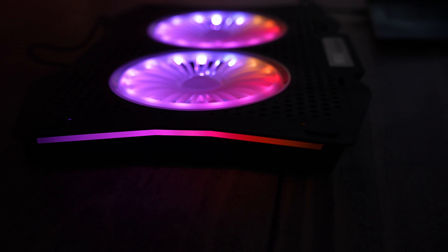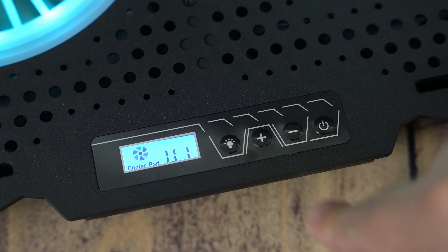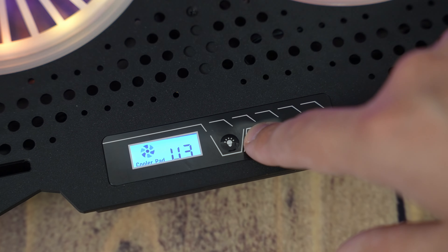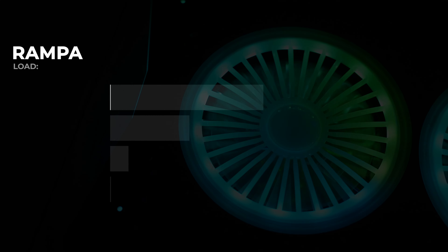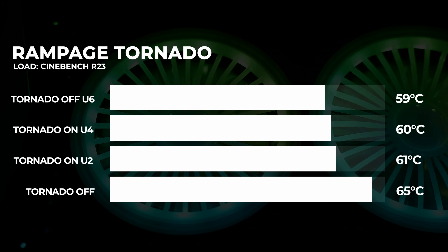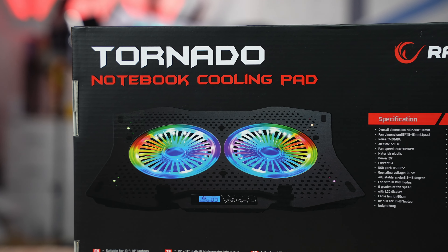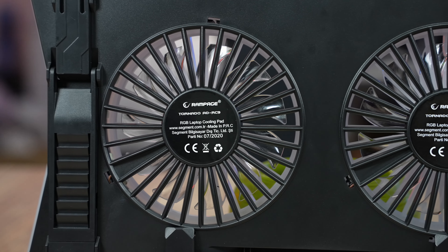After nearly an hour, here are the conclusions. Let's start with temperatures. The Tornado can be set to six levels, labeled U1 through U6, where U1 is the quietest and U6 the loudest — the fastest fan. We tested at U2, U4, and U6, and with the Tornado off. As you can see in the table, there is exactly six degrees of difference between Tornado off and Tornado on — which is not small. But the story is a bit deeper. When the Tornado was off, the processor was boosting up to 1750 MHz. When the Tornado was on at maximum, it boosted up to 2000 MHz on all cores. So the frequency difference was considerable, meaning the actual thermal difference is much, much greater.